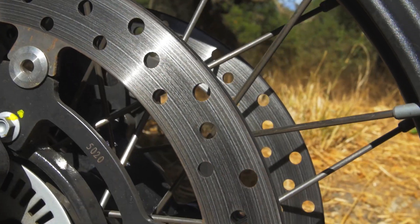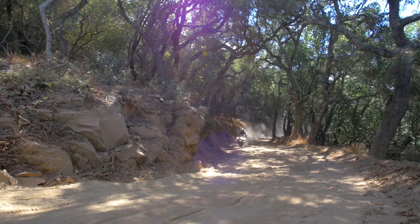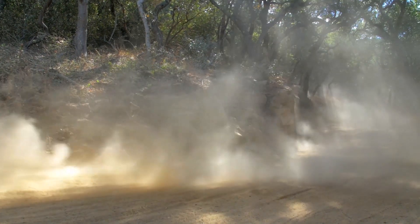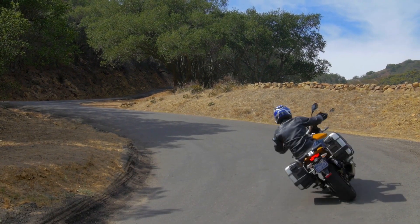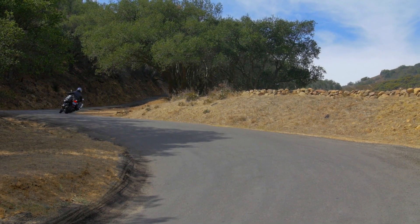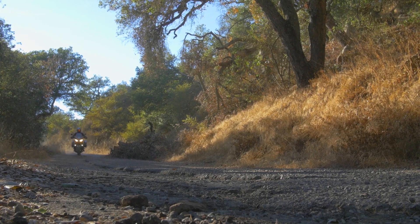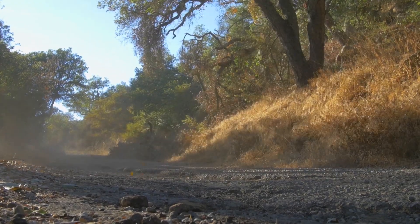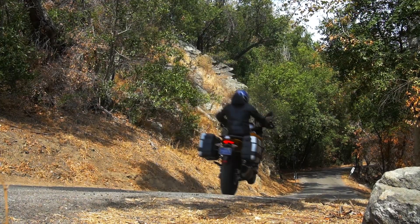You've got a 19-inch wheel on the front of this bike, which really helps because when you're going off-road you've got obstacles to go over and a small wheel has more difficulty doing that. Now as you can see, we've got street tyres on this bike so it's spent most of its time on the street. However, I did take it trail riding — it handles the trails just fine, though it would do better with some dual sport tyres. Its biggest downside off-road is its weight.